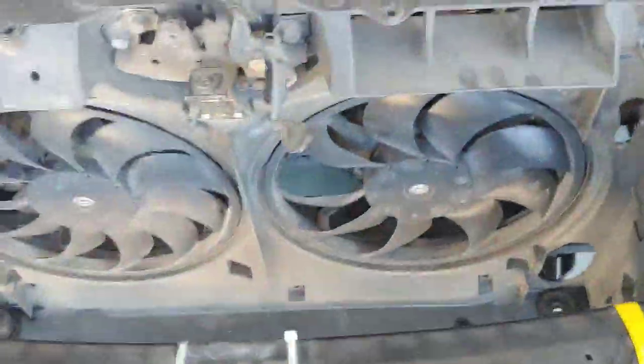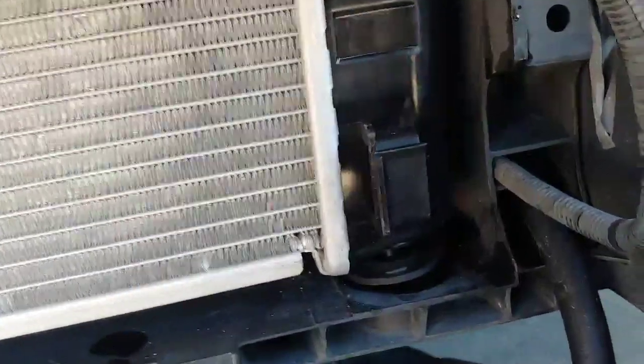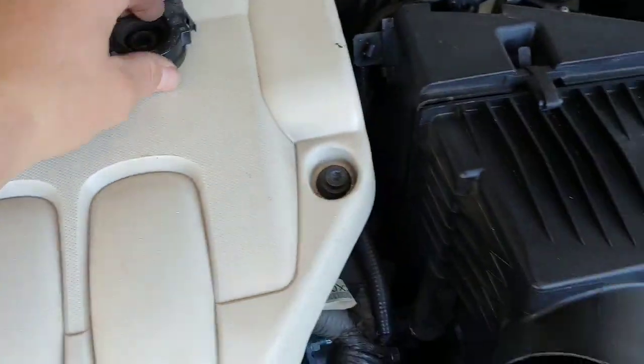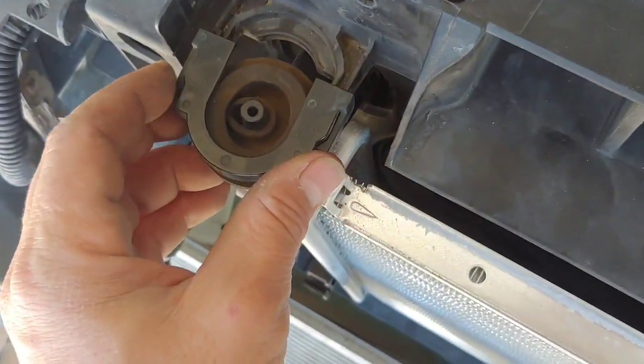This is the new one, so I'm gonna go ahead and put it back in and start hooking everything up to it. I slid it back into place basically the same way I took it out. It's got these little pegs down at the bottom that slide right back into those little rubber grommets. Everything should sit in there nice. Put these clips back on — they'll even tell you which way is up. Set it on there, line it up, push, hear it click. One on each side — hear it click. Radiator's in.